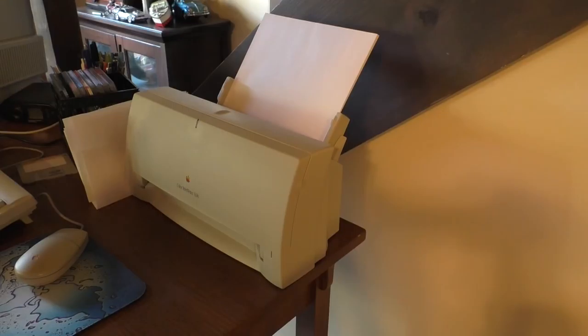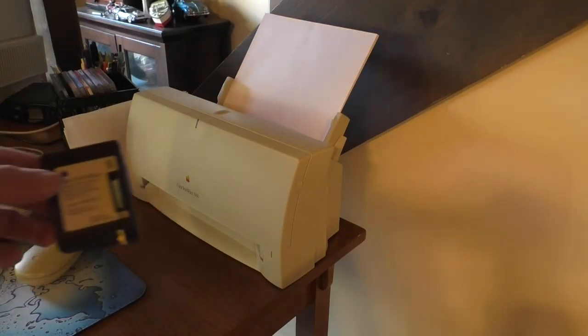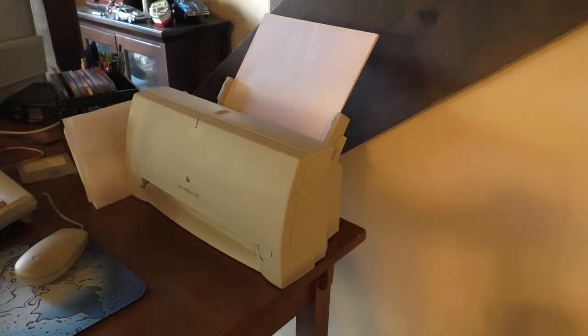When you open that cartridge from its original package, there wasn't that hiss that you want to hear with a brand new sealed cartridge. And they were definitely gummed up beyond all hope. They could be revived, maybe with some isopropyl alcohol injections, but I'm not going to bother. Here's the original black cartridge. The color cartridge has already been thrown away.